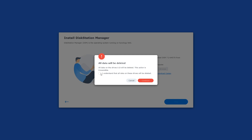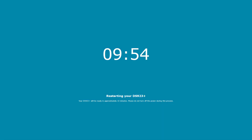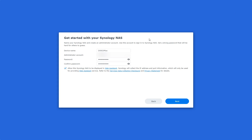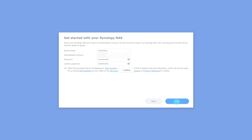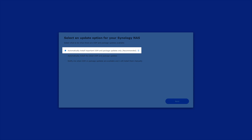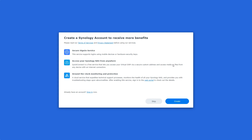Keep in mind that all the data in your hard drives will be erased. Keep the NAS turned on during the installation, which will take about 10 minutes or less. Once done, it will reboot automatically and you'll hear a short beep when it's ready. Once it's done, click Start, then fill in the information together with the DSM admin account details that you want to use. Click Next and select the options you prefer, but I suggest selecting to have the latest DSM version installed automatically.